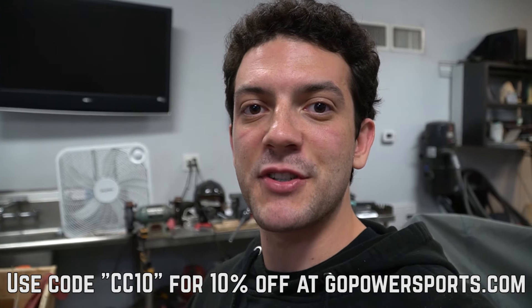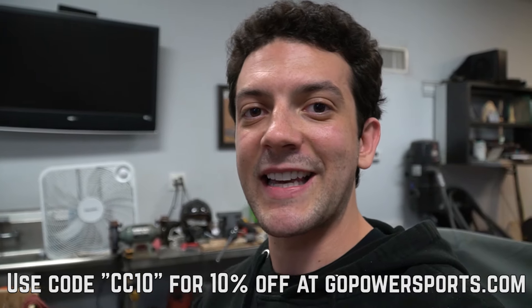I just installed a header on our engine — one that Ike had laying around from one of his other Briggs and Stratton five horsepower engines. Since these old Briggs engines are so prone to carburetor problems, we're just going to skip it and stick a 22 millimeter Mikuni carburetor from gopowersports.com. The 22 millimeter Mikuni is one of our personal favorites for small engines — it's not good for a stock engine, but for a stage two 212 it's great, maybe even a stage one 212. It's a great step up from a stock carburetor. You can find this carburetor at our link in the description from gopowersports.com and use discount code CC10 for 10% off most products.